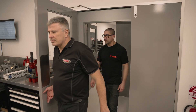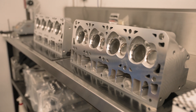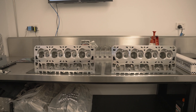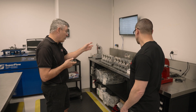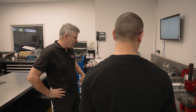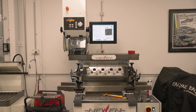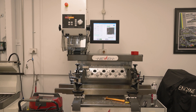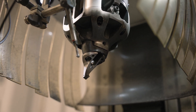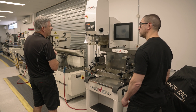This is our machine shop where we do probably 80% of the machine work in-house. There are some cylinder heads for the new Gen 3 supercar engine - LS9 cylinder heads. We're trying to run as many factory parts as we can on that engine. The LS9 runs a titanium intake valve and sodium exhaust valve, so we'll probably go to a titanium exhaust valve. It's basically a factory CNC-ported head, so a quarter of the price of the current heads we run now. We've got a new machine for cutting all the valve seats - it's a touch screen where you program all your valve angles in and it'll go down and cut the seats to whatever settings you put in, compared to the old type with a form tool where your angles were cut on the cutter. With this you just put in whatever design you want.